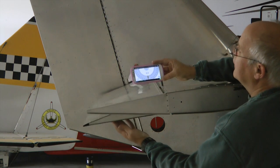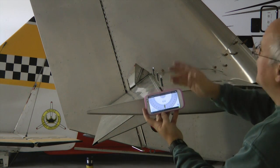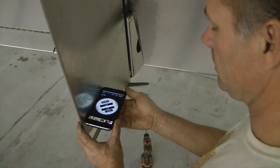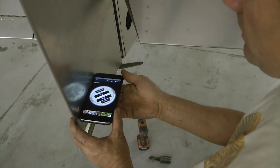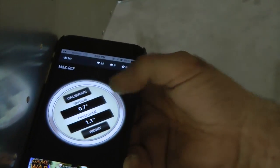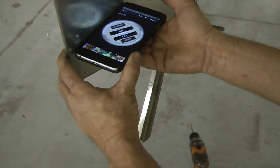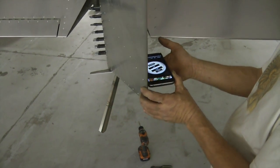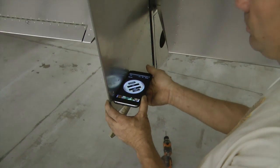Something to try — everyone has a smartphone now, and it's accurate enough for this type of purpose. Get your iPhone out, or one of those other devices. Get your angle finder downloaded from the app store. Calibrate it to zero and then move it and see if you have 18 degrees, or whatever you want, in one direction and the same in the other way. You just calibrate it when it is centered, then go one way or the other.